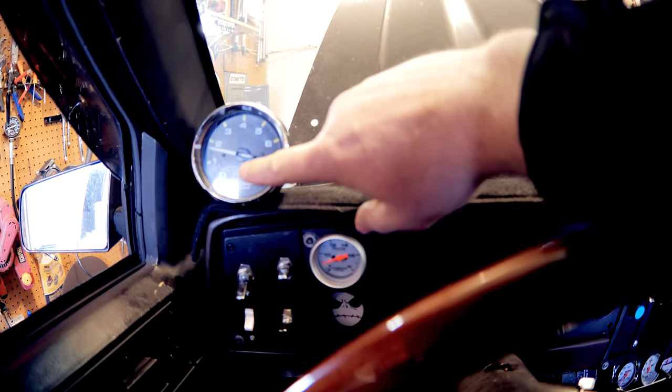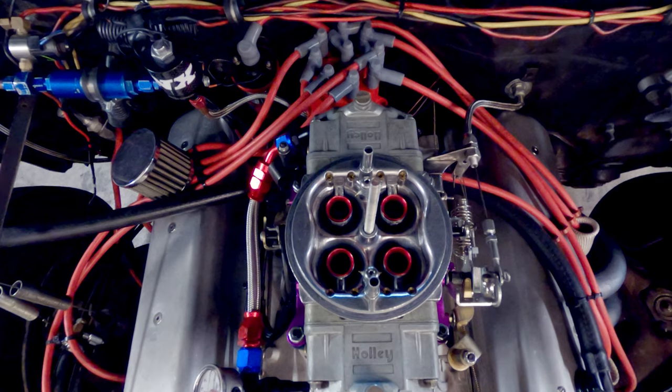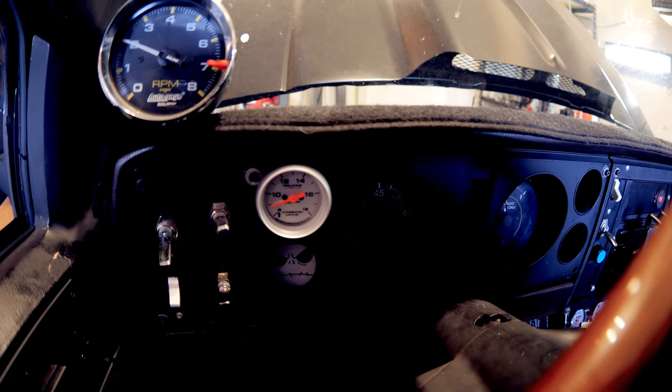I'm not going to pump the gas. I'm going to turn the motor over, now I'm going to pump the gas. Let's wait and see - all I'm doing is keeping it running. You don't want to go over 2000 RPM at this point, you just want to keep the motor running.